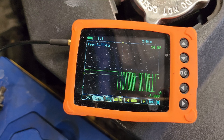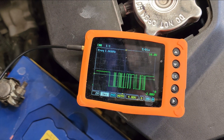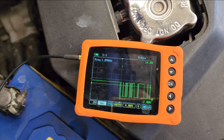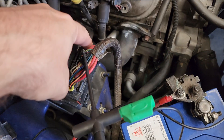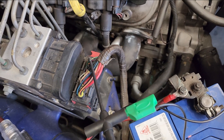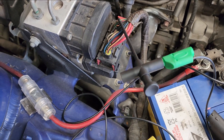A little bit more activity now. Because we've got that signal there, how do we know if the ABS module is sending that and we've got a broken wire to the body control module, or if the body control module is sending this to the ABS and the ABS is not responding? The way to do it is disconnect this plug — that obviously leaves that wire intact with the body control module and the instrument panel — and if we're still getting that same signal, then we can pretty safely assume that the ABS module is not responding.